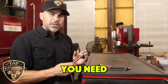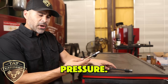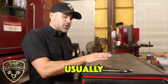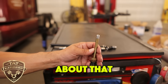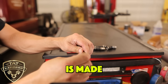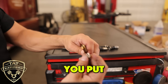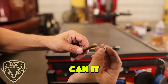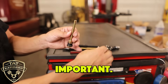When you need to add air, you'll see the same type of setup. You're going to need an air supply system of over a hundred pounds so that you can get the right pressure — usually tires are going to run about a hundred PSI. This cap is made to protect the valve stem on the inside. Anytime you check tire pressure, it has a seal on it so that it seals out any moisture from going inside this valve.